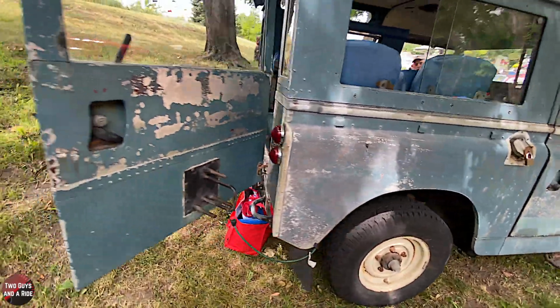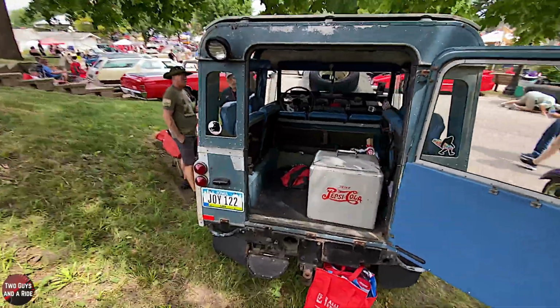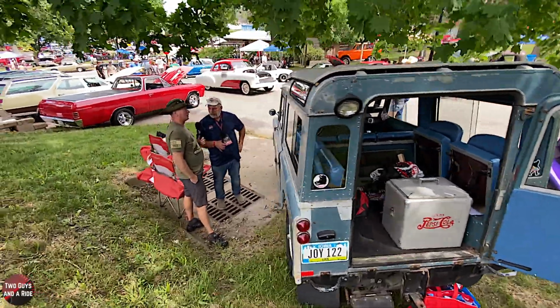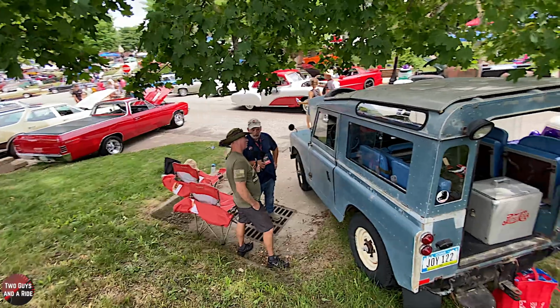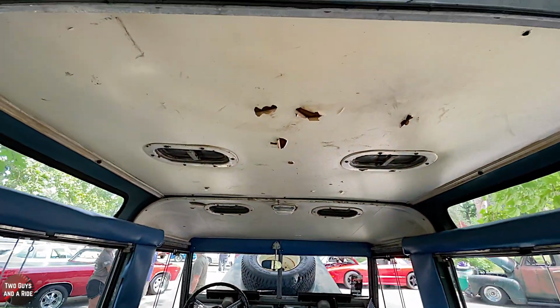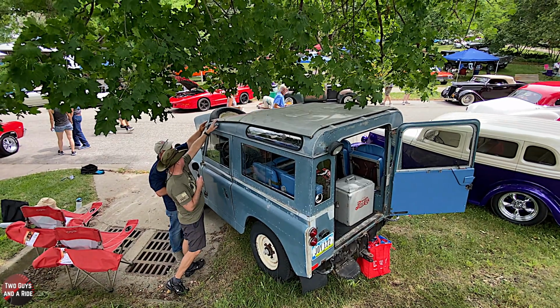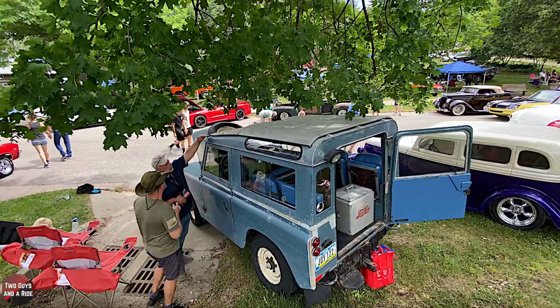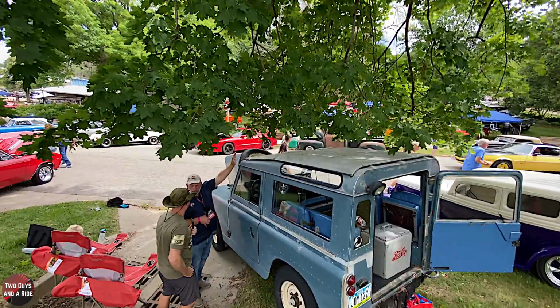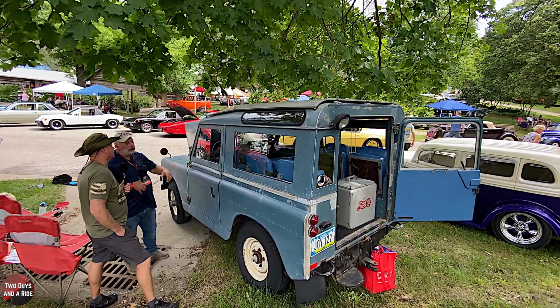Oh man, tell us a little bit about this. I believe the Safari roof. Yep, the Safari roof was designed to keep the sun off the passenger roof. Off the cargo roof. It has 4 vents. There's also the extra height in it too, so that allows air to get through and allows the sun to hit the top and not the cab. And then it would heat up, and the idea is the heat would dissipate. Air would go through there. But then you would still have the 4 air vents inside that you could pull open.